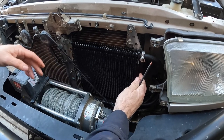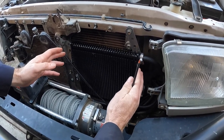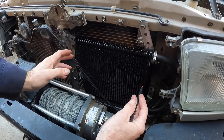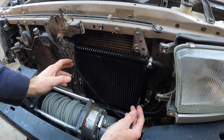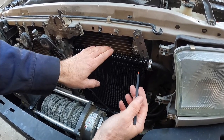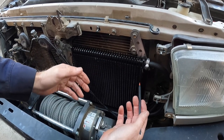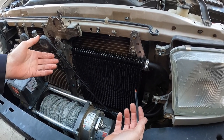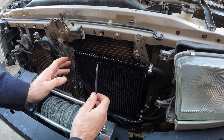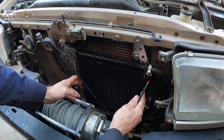The install turned out pretty damn well. My buddy Ton helped me and I think we did a bang-up job fitting this thing within the available space. When installing, the main thing you want to make sure of is that the cooler doesn't rub against anything metal. We were really careful making the brackets so the cooler isn't contacting any part of the body — over time, rubbing could wear a hole in the cooler and cause it to fail.